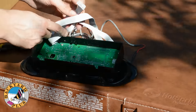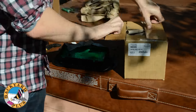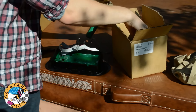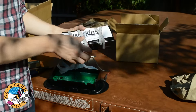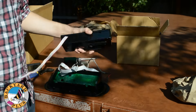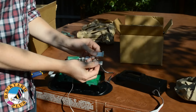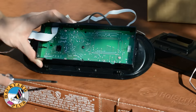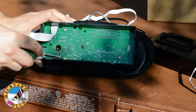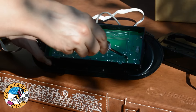The connector on the old control head is not compatible with the new control system. The new control head is part number 73225 and looks very similar to the old one. It will mount on the back of the control panel the same way the current control head is mounted. As you can see, there is a pretty big difference in the two connectors. There are four screws that hold the control head to the control panel. To remove the old control head, loosen the four screws in each corner of the control head.